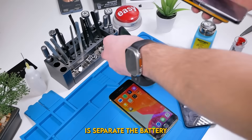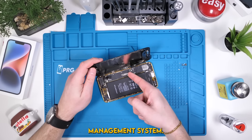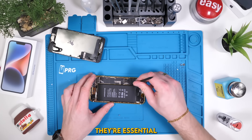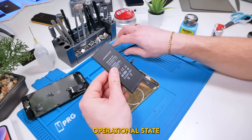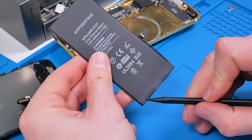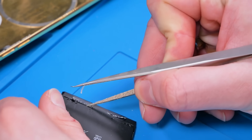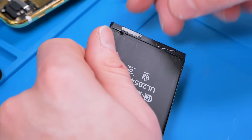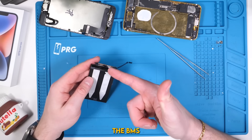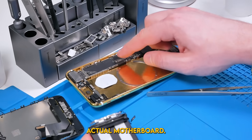The first thing we need to do is separate the battery from the BMS board. BMS basically stands for Battery Management System. They monitor the battery, provide battery protection, they're essential for estimating the battery's operational state, and they're continuously optimizing battery performance. The BMS board is located right over here and it's spot welded to the battery. To remove it, we have to remove this black piece of tape, which will expose the BMS board, and then we'll give it a little snip. To dumb it down, the BMS board is basically the thing that communicates between the battery and the phone's actual motherboard.